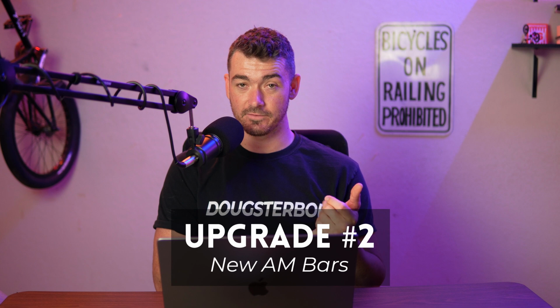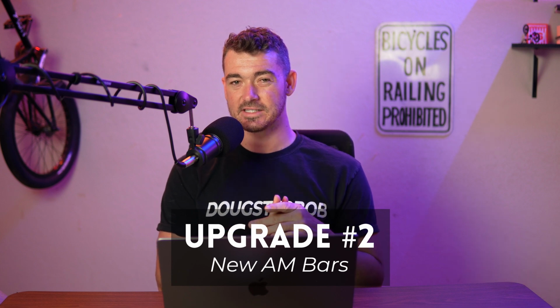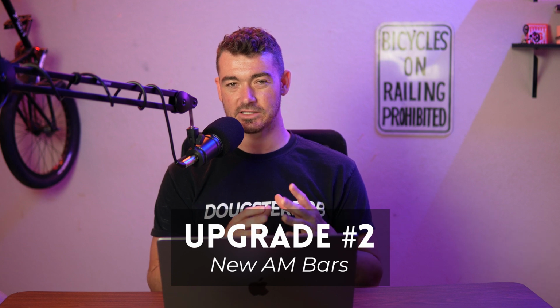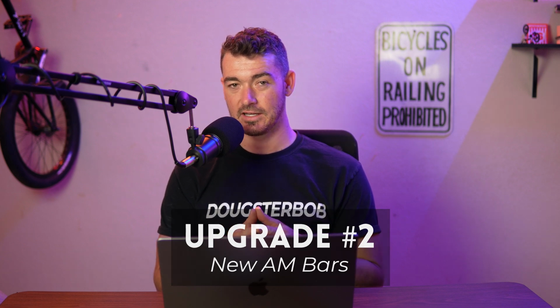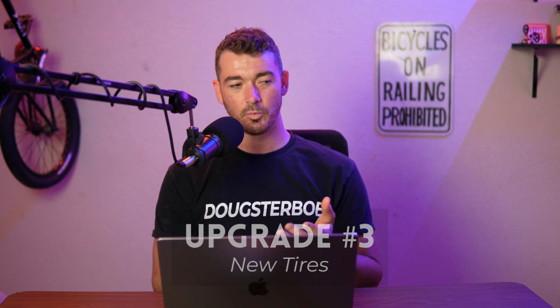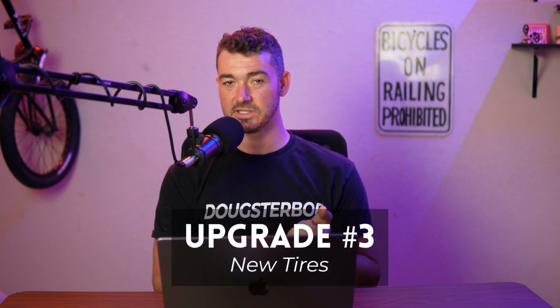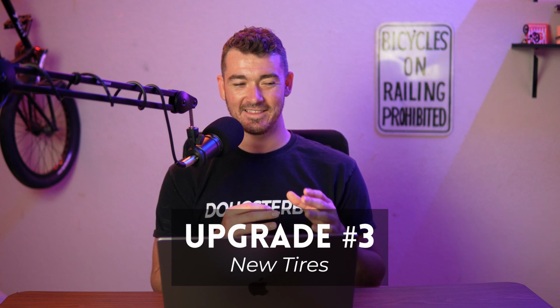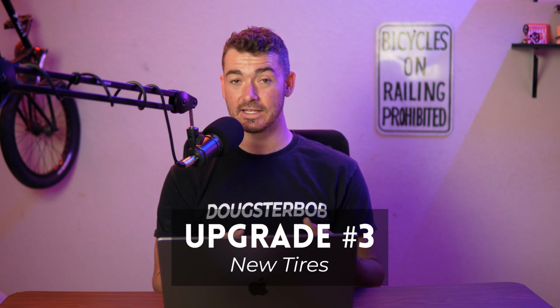Next, I'd recommend grabbing some new bars. Since the forks are fully aftermarket, it'll be nice to complement them with aftermarket handlebars instead of just the 2-piece chromoly bars that come on this bike. The third thing I'd say is upgrade the tires. These tires are the low PSI, so you're going to get high rolling resistance, and they're also pretty heavy. You can buy lighter tires that will affect the weight of this bike. It'll probably get it down under 25 pounds if you upgrade to good Kevlar folding tires.